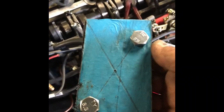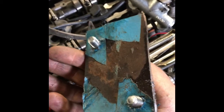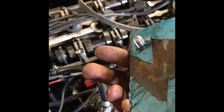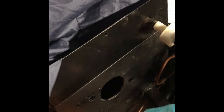I've cut a bit of plate out roughly the right shape, which will be trimmed down later. It's quite thick plate. I've drilled it a little bit over 10mm - the actual bolts that originally held the servo on the pedal box are 10mm diameter. I measured from the center of one hole to the other, which is 90mm, giving a little additional room so I know it's not going to sit square.